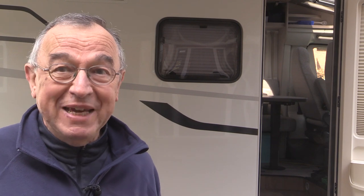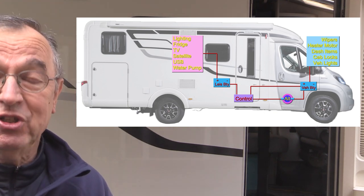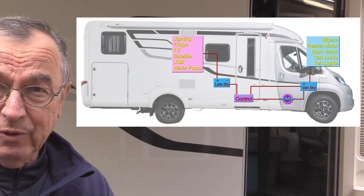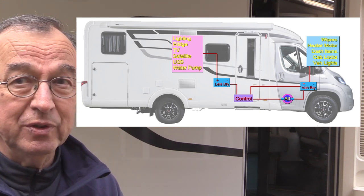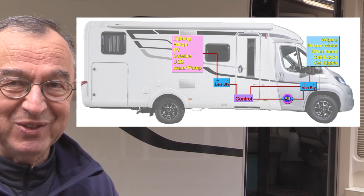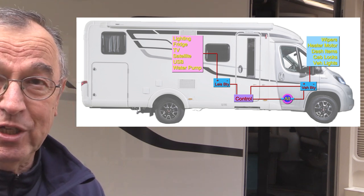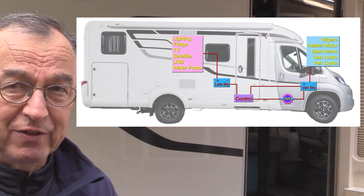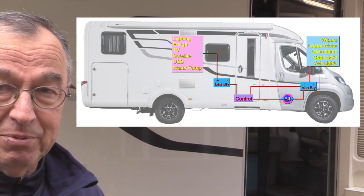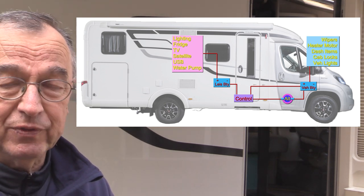If you're not on a campsite and there's no mains electricity to plug into, the leisure battery should provide the power you need for all the bits and pieces inside the motorhome. Your refrigerator should be able to work on 12 volts, and your internal lighting will work on 12 volts — or 24 volts if it's a 24-volt base vehicle. You may also have USB sockets dotted around, powered through the leisure battery. We also have a TV and satellite, all working on the 12-volt low voltage.